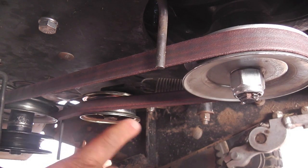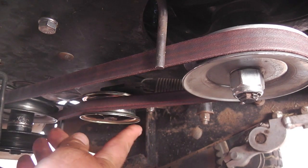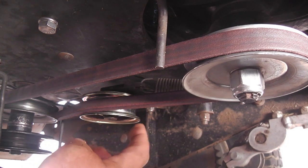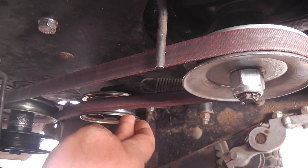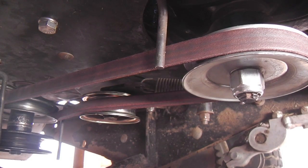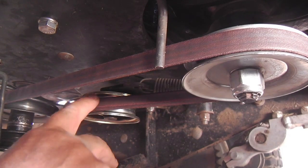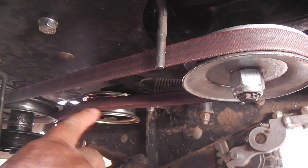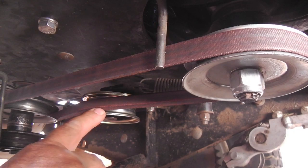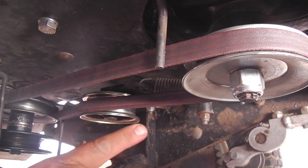So I got an idler pulley that was taller. It sits up, there's a quarter of an inch more for the belt to ride inside. And I also put a nut behind it as I installed it so that it would hang down lower. And it's good. I'll disengage and engage, and it does tend to ride very close to the center of that idler now. And even if it does get close to that edge, that's a flared, rounded edge. So it's all better. But pay attention to those things.